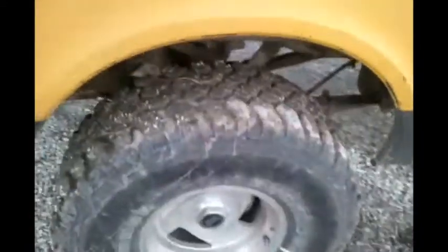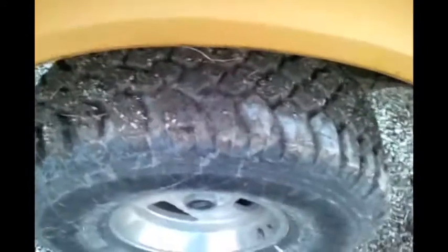This has gone on eleven minutes. I got my fuel gauge to work, and this thing burns fuel like crazy. It's not cheap and it's squirrely. I was asking what lift this was — these are 35s, and I think it's about a four-inch lift. I gotta measure these front blocks because they look a lot like four inches. I gotta get front leaf springs — I'm getting rid of that blocked-up front end because it drives squirrelier than shit with a blocked front end. I don't like blocked front ends.